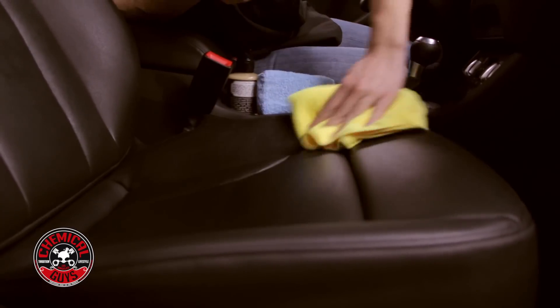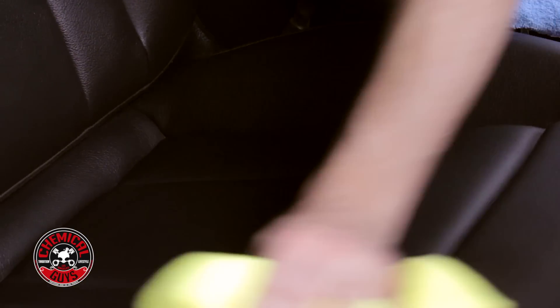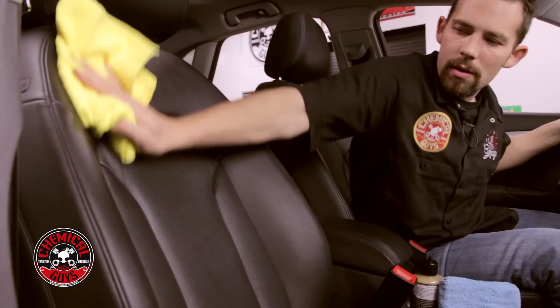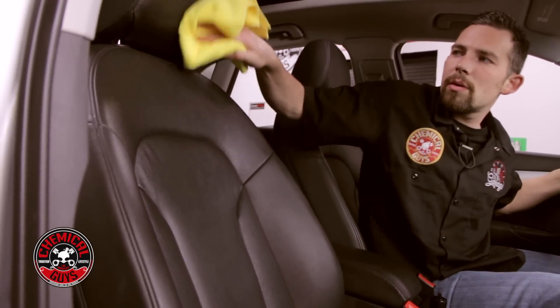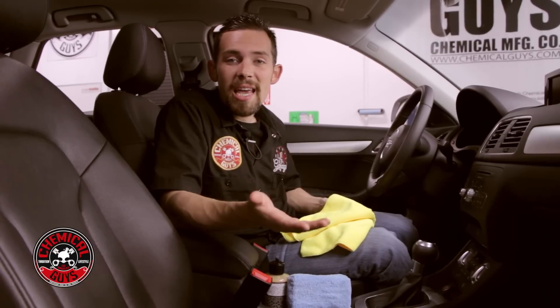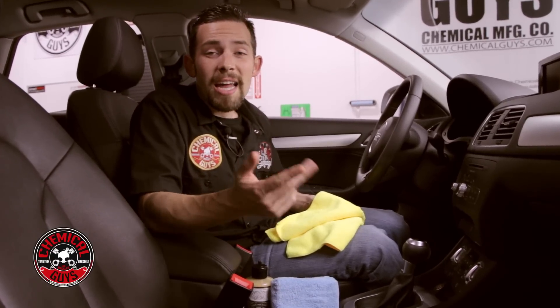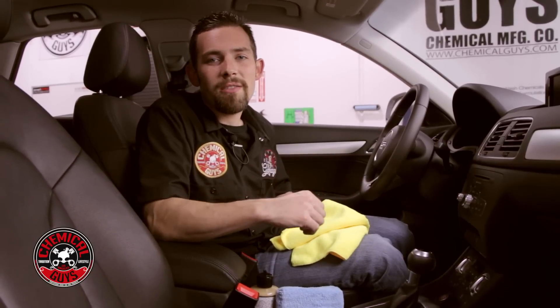Now I'm going to the seat to buff off the serum, moving up to the top, and then doing my armrest. Now our leather looks its best and it's going to stay looking good for a long time. Even if you have an old car or a new car, you still need to take care of your leather — clean it, condition it, and protect it often. I like to do this every couple months to make sure the leather stays looking good for years. One thing you don't want to do is neglect the leather, because over time it leads to discoloration, cracking, and the leather feeling hard. If every couple months you condition, clean, and protect your leather, it's going to stay looking good and feeling soft. Hopefully now you know how to detail your leather just like a pro — see you next time right here in the Detail Garage.